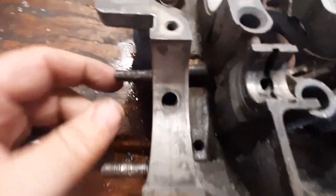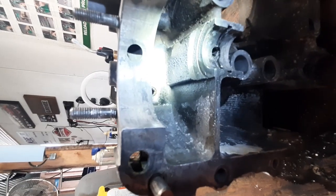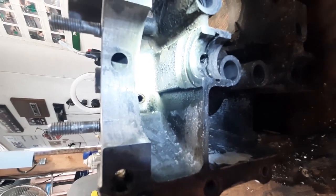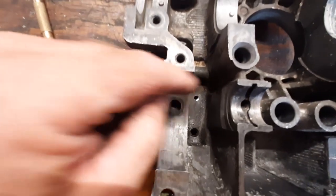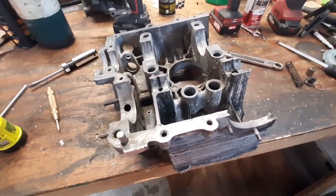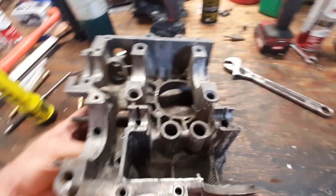What we need to do is drill a hole right in there, slightly downhill from where this hole goes to the main bearings. When it's pushing oil to the main bearings and the pressure is still too high, the piston will go a little further and start squirting that oil there to keep from having too much pressure. Right there is the required hole for oil pressure relief — needs to be two and five-sixteenths up from the bottom here, or basically straight in line with your upper oil pump stud. That should give you, according to the plans, about 50 pounds cold and 45 pounds hot oil pressure. It'll slide down to bypass the cooler, and if you've still got too much pressure, it'll slide down and start venting oil out here.